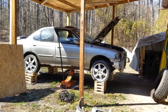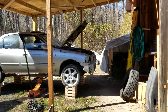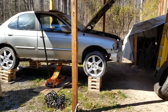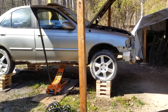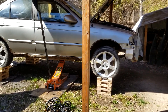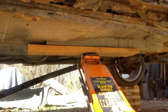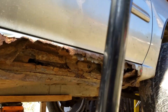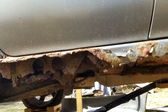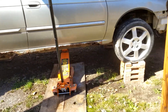We're going to pull the wheels off this car because the wheels currently on it are 17x6s — these replacements are 17x7s. On the track, when you don't have power you might as well have grip so you can corner faster. I'm going to try to use a board to spread out the weight of picking the car up because week by week it's losing more of itself, so we'll get the wheels off and set it down on its frame rails before stripping every good part off it.